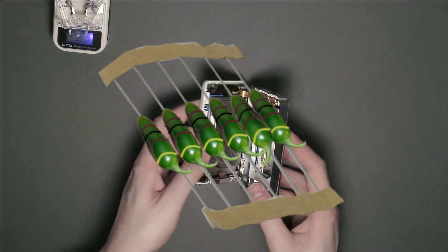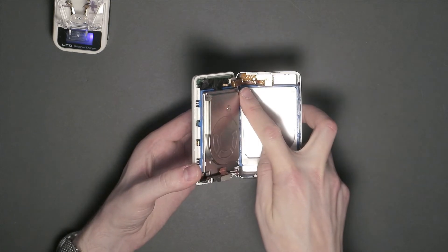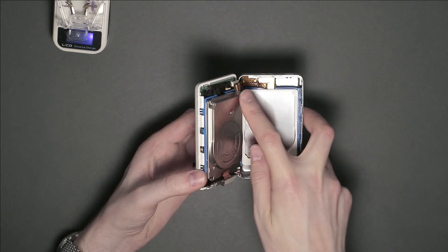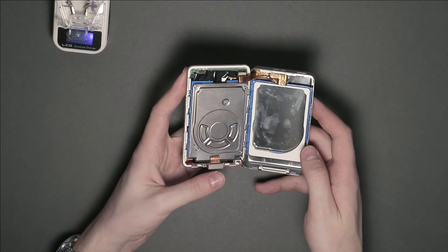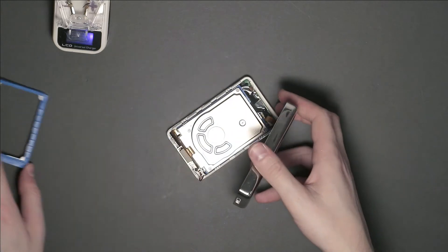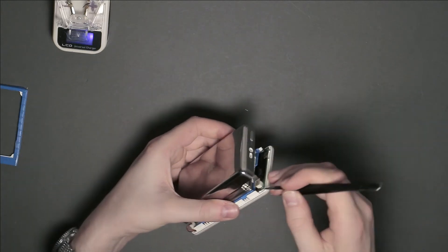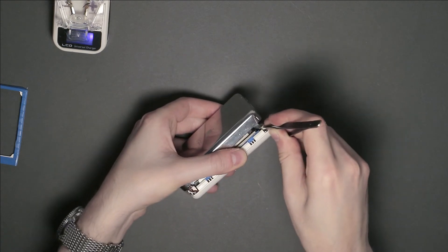Hopefully they didn't mess with my jalapeños. Note that the back is connected to the rest of the assembly via this ribbon cable — care must be taken not to rip the connector off by accident. Don't pull on the cable to disconnect it. Instead, use some tweezers to disconnect the cable by pushing the connector away from the socket, like so.